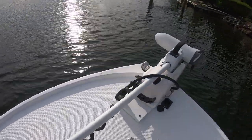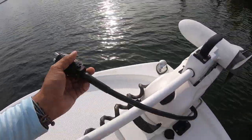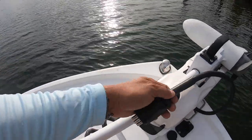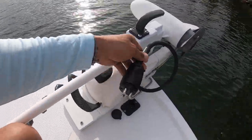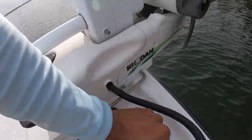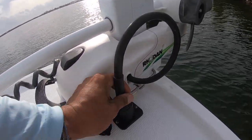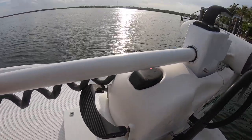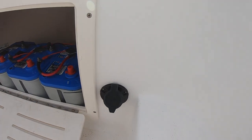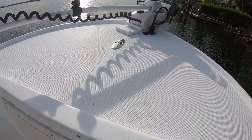When you come up to the deck here, I trimmed the excess off of the trolling motor cord — got it down to about 18 to almost 24 inches. The recommendation is to leave about 6 to 12 inches of slack, which is what I did. It just curls over and you install it — the plug can only go in one way. It self-indexes and just connects right in. The motor is on, sensing that it has electricity. You should always disconnect this if you're powering up the motor so the power bank charger doesn't get affected.